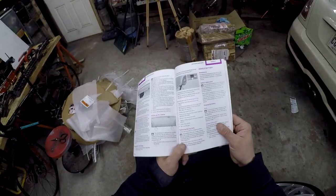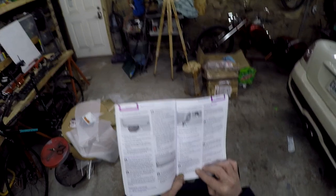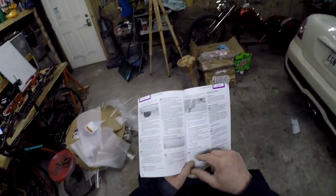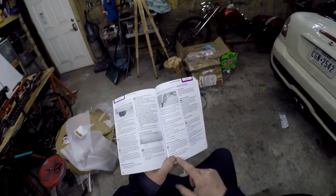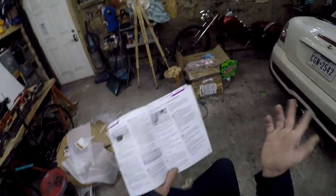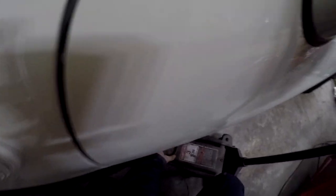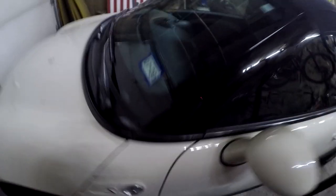One seventy-five — 103.3 foot-pounds or 140 Newton-meters. This is why I looked this up: because if you're changing your wheels and tires, you need to know where to jack it. This section shows you where your jack points are. Whenever you're jacking up your car, you want to make sure you hit those jack points. Most new modern vehicles are unibody — you can't just put the jack somewhere on the frame. You've got to find that jack point. On this car, there's one right there.